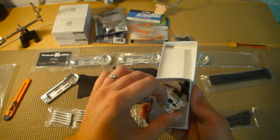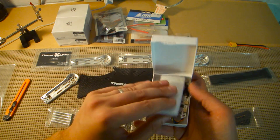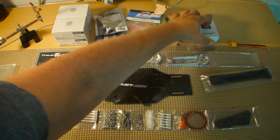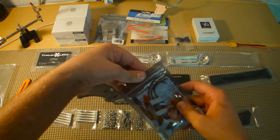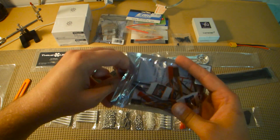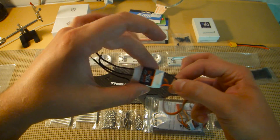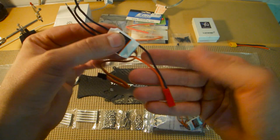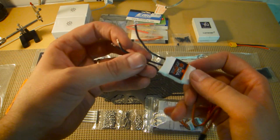I'll be using a breakout cable to go to my AR-6210 receiver. I took the satellite receiver and just left it on the Spanky for now, so this will be the receiver I use for it. ESC-wise, I'm going to go with some T-Motor 12-amp. They're pretty nice. Interesting that they come with a JST connector, but obviously that's going to get cut right off to be mounted onto the power distribution board. For the right person or use, it's probably pretty nice just to be able to plug and play.